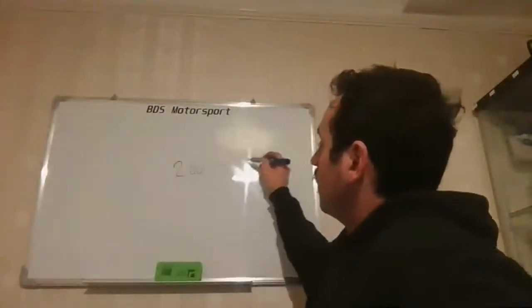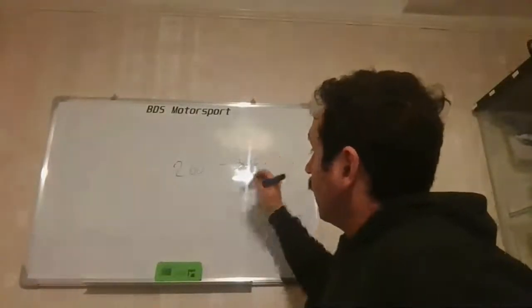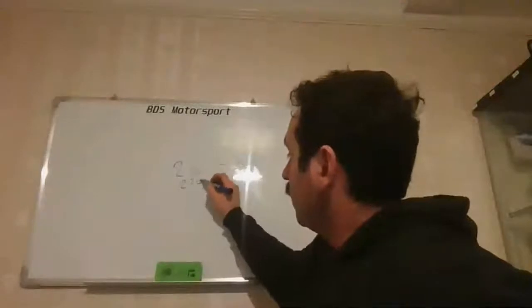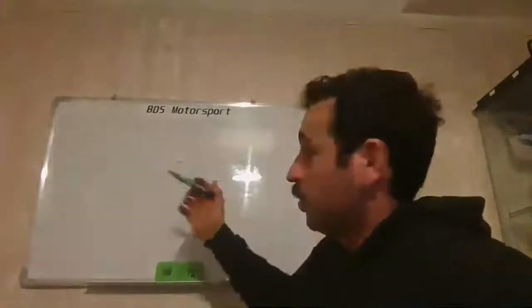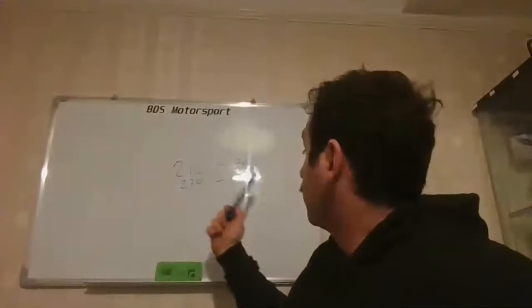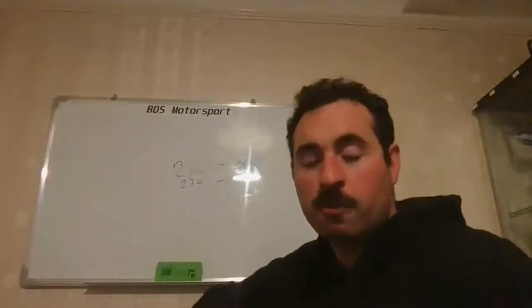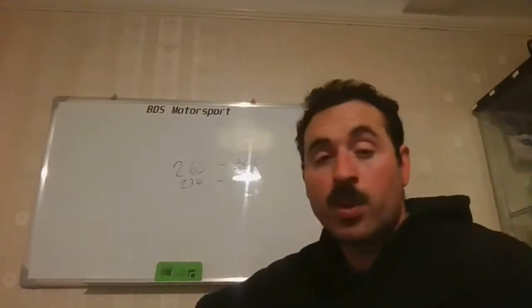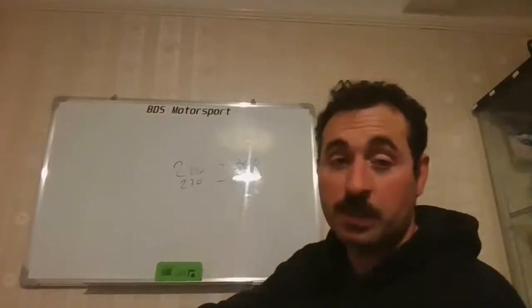For example, say you have a head that has 260 CFM with an average port speed of, sorry, let's say 300. If you find an area where you can get it to 270, but port speed drops down to 250, it's not worth doing, because it's not a great move. It means you can make more peak power, but you're going to have less average power because you're not going to be making as much torque. This is where it's very important to balance it. You gain 10 CFM at the cost of 50 feet per second.